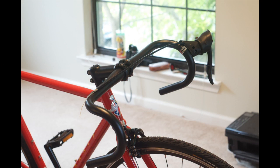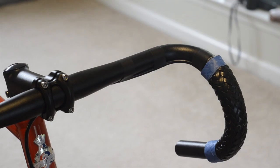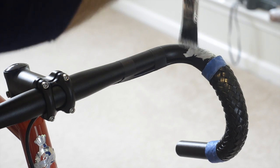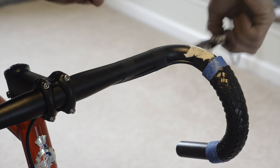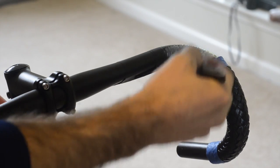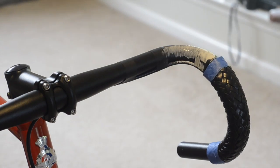To start, mark the top and bottom edges of your brake levers. After you've taped your cables, tape the end to the bars to keep the end of the cable from sliding into the braiding. Slide the top portion of your braided grips up to the level where your levers will sit and just over the end of your cable housing.